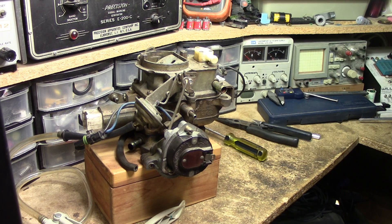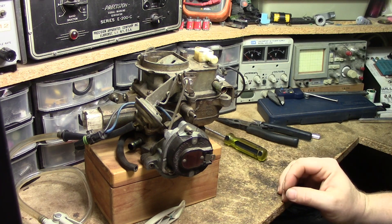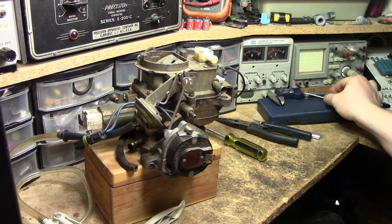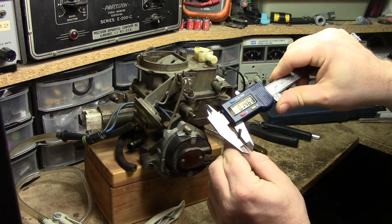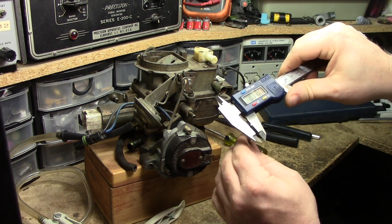Within AMC's TSM — or Technical Service Manual — it does specifically tell you the initial choke valve clearance. The set-to is 0.140 inches for the 8338 and 8339 Carter 2BBDs. The OK range is 0.125 to 0.155. There are little gauges you use to set this initial pull-off clearance, but I don't have any of those, and it's entirely possible you don't either. So what I want you to do is get yourself digital calipers and go into your pile of nails. We're looking for a nail that's within that OK range — this one here measures 0.146 and maintains that throughout the length needed.